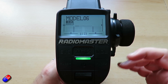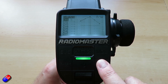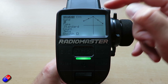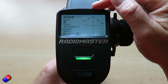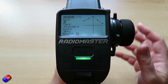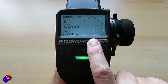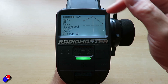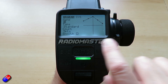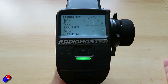There are a couple of things I've done here. If we go into the model menu and zoom across, I've created a curve — let me select this and show you how it's set up. This is just a standard five-point curve. You could have a flat spot in the middle so that around very fine throttle positions you always get 100%, but it drops off as you move either side. The throttle is normally in the middle position and goes left and right, and by moving these points we can change the relationship. Going forwards reduces it more steeply; going backwards reduces it less.